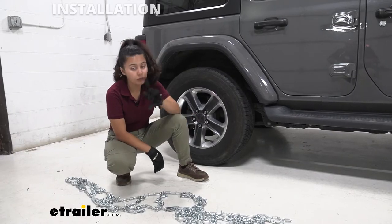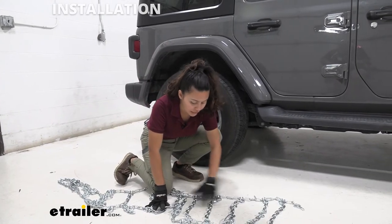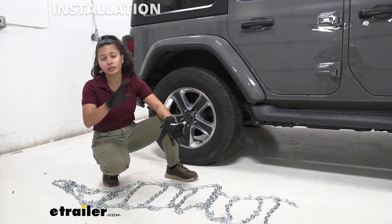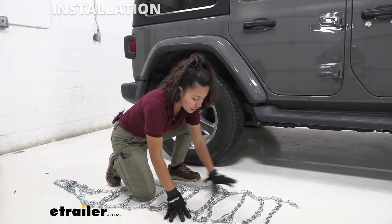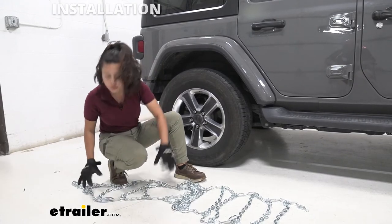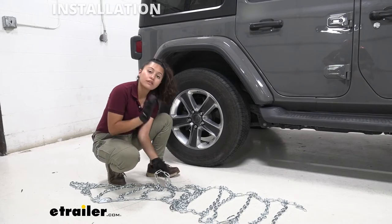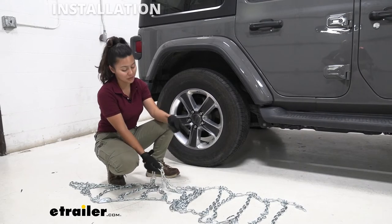When you get your tire chains, I recommend first laying them out on your garage floor so you can get a handle on how they work and how they look — get familiar with them now before you're stranded on the side of the road where it's muddy, snowy, cold, and uncomfortable. Check the links to make sure they're not tangled and that none of them are cracked or broken. Also make sure the hook portion faces away from your tire while the flat portion is on your tire — that's the proper way to install it so you don't accidentally puncture your tire.